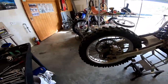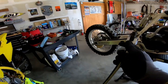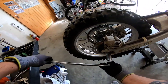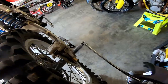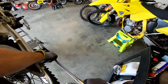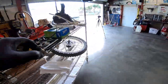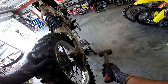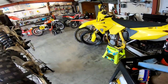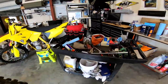That looks like a 30 millimeter maybe. I was wrong — it's more like a 28 millimeter, and I found a 1 and 1/16ths that fits perfectly. I did not have a 28 millimeter so we'll go with that. I'm going to be careful not to flip the bike over or hit yourself in the face with one of these suckers. Axle block, axle nut, and rubber mallet. That is in there. Not too bad though — a lot of bikes this age would be in a lot worse condition.